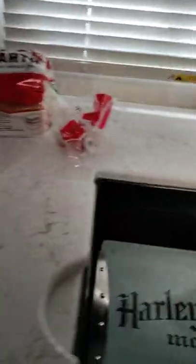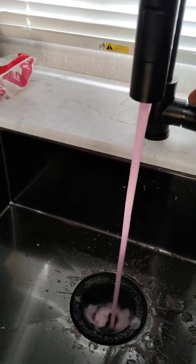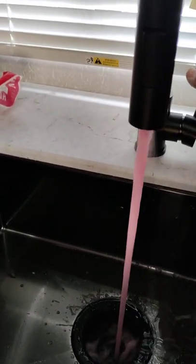Then go over to your sink. Get everything out of your sink and turn the water on until the pink antifreeze comes out. Get the line drained out — make sure you run enough to fill up a little inside the trap so it doesn't crack and freeze.